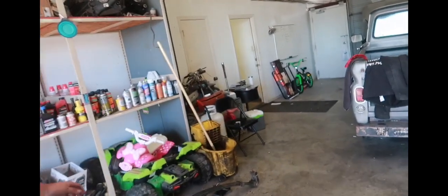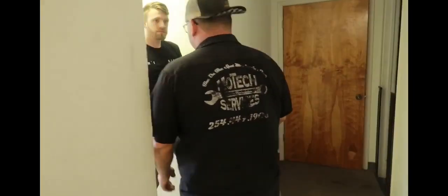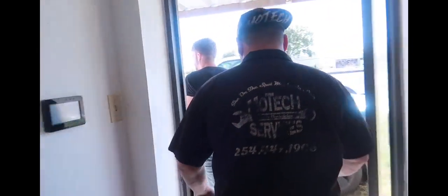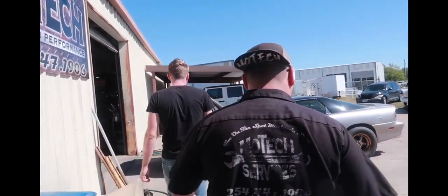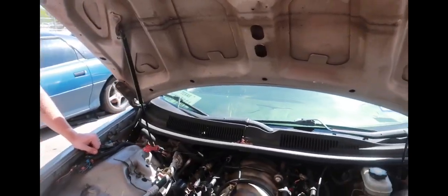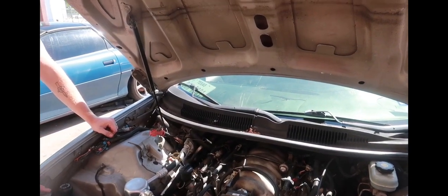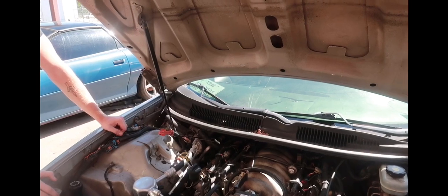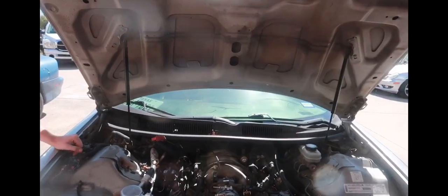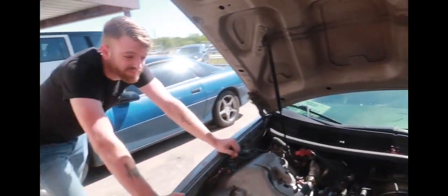We gotta get Cracker Zack's prediction — he's probably in there editing videos. Let's go see. Predictions — we're trying to predict the rear-wheel horsepower after the tune. It's a 6.0, 243 heads, stock, not ported. It's got an MS4 cam — pretty big cam. Swapping to the LS6 intake, 4000 stall, built trans, and 410 gears. His prediction: 415.